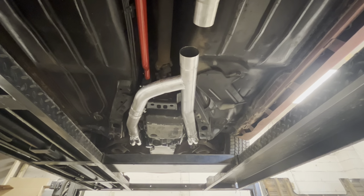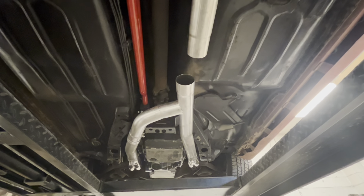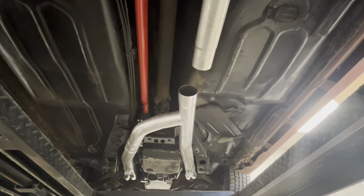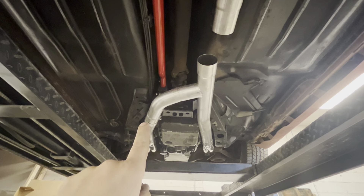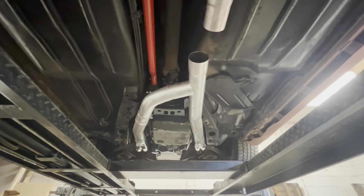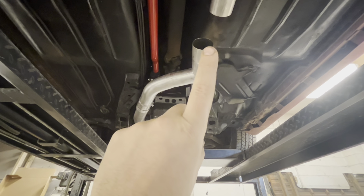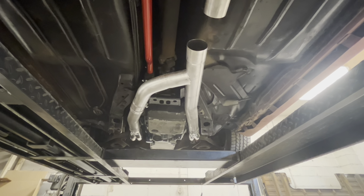Here's the finished Y-pipe — it turned out really good. These pipes do line up; everything's just loose right now so once I tighten everything up they'll come together. I have that little intermediate pipe that connects the two already made — it gets clamped on both sides. The Y-pipe goes on and off really easy, which is good for future mods or if you need to service anything. I'm going to get this pipe in, get everything where it goes, tighten it all down, and then we'll be ready to fire this thing up and see how she sounds.